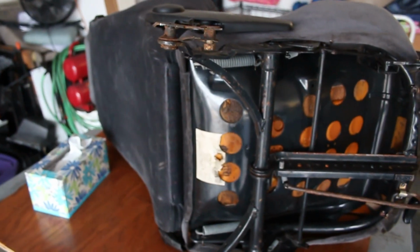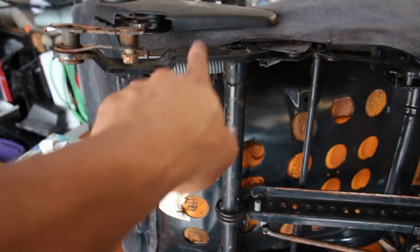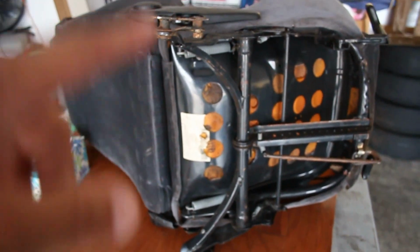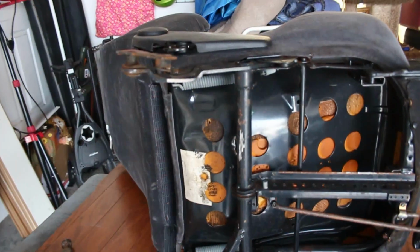So essentially all I'm doing today is cutting this brace piece out so we can press this arm the rest of the way out, because MK2 bases are not as wide as MK3. These are 19 wide, MK3 are 21 inches wide, so you have to make the bases 2 inches wider to fit the MK3 rails, so that's what we're going to start with today. Alright, step one, remove bracing piece is done.